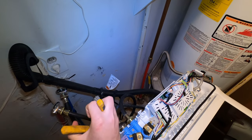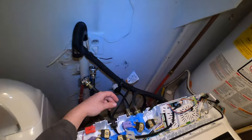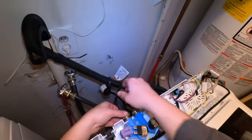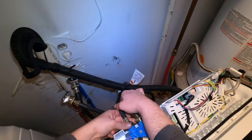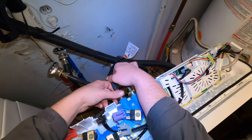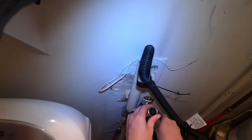We're working on getting this sucker out. You saw me get off all those connections and turn the water off, unplug it — make sure y'all do that. Once we get those off, we got some work to do on the underside. That's why you need to tape off that door and not hurt yourself — you guys will know what I'm talking about if you do not tape that door down. That sucker will spring open and hit you in the face. Getting these hoses off, got the wire connections off. We are going to have to move some more wiring out of the way because we have a thermistor we have to disconnect, which is on that valve too.